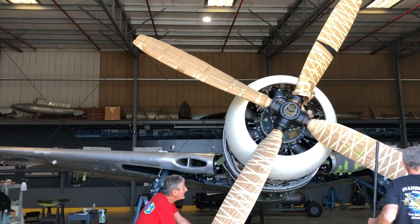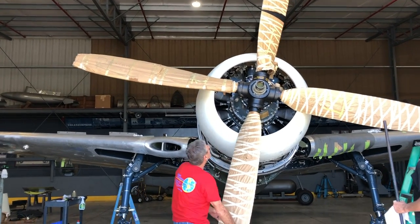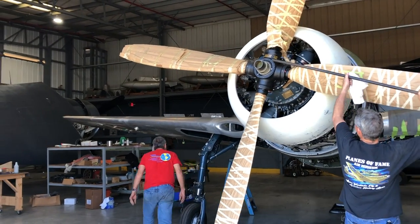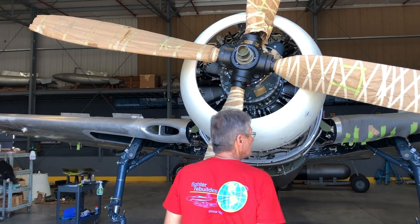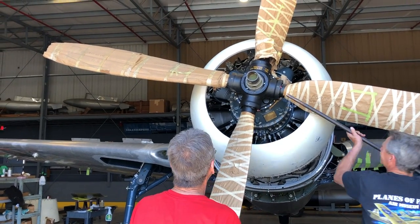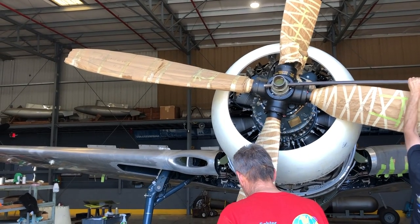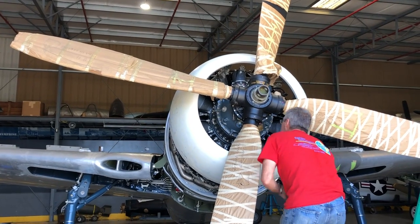The critical altitude was around 22,000 or 23,000 feet at full power — that was one of its unique features. Looking at the nose of the Bearcat, you can see it's nice and clean — the engine cools really well. It's rated at 2,000 horsepower at 53 inches and 2,800 RPM without water injection. We push it up there occasionally, but not all the time — the fuel today isn't as good as what it was designed to operate with.